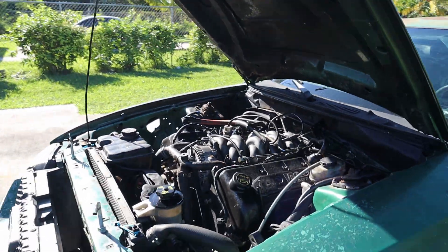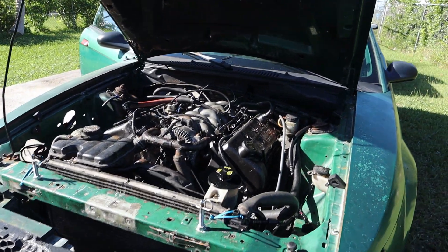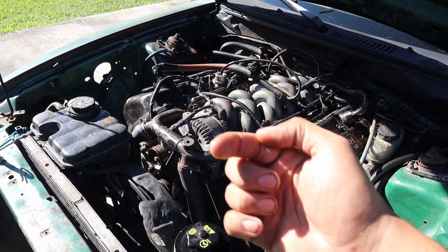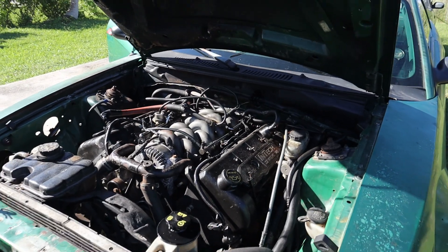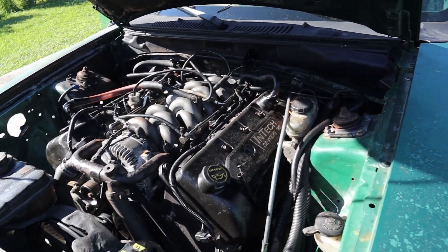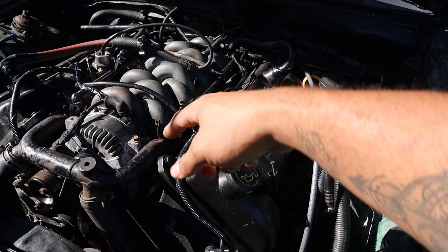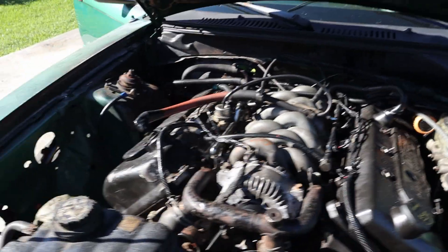Let's talk about the flywheel. When you take the flex plate or flywheel off of whatever four-valve motor you're putting in, you have to make sure that you have the right flywheel for it. Some of these motors have a six-bolt pattern in the back and some have an eight-bolt pattern. Most Mustang GTs are gonna have the six-bolt pattern, so you just need to verify you have the right flywheel for whatever crankshaft comes in your motor. This motor was the first year they ever made the 4.6 twin overhead cam. These are 2003 Mercury Marauder valve cover pans because I used to have a 03 Marauder motor in here until I bent a rod and had to swap it out.